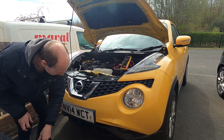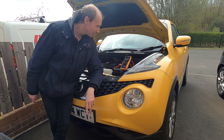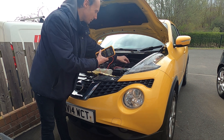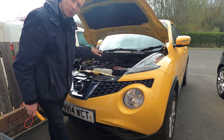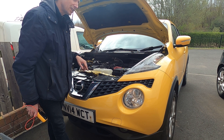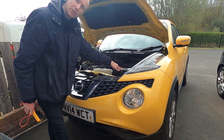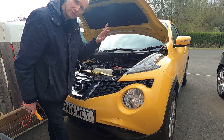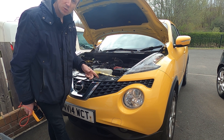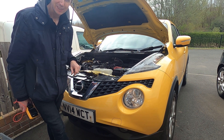Sadly that's not much of a definitive fix this time — I was really hoping some of those glow plugs were going to be bad and that was going to be a fairly easy fix. But at least you saw how to get at the glow plugs and know how to test them on the 1.5. This is the Renault 1.5 K9 engine, the dCi. Get the battery on charge and let's see if that helps our cold start — fingers crossed. I hope you like this video — please give it a thumbs up, stay subscribed for more videos, or pop any ideas in the comments below. I'll see you next time.